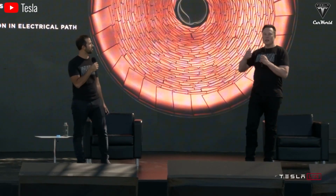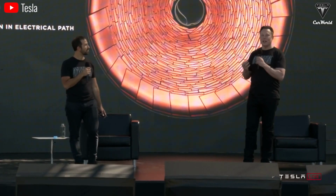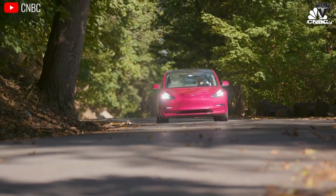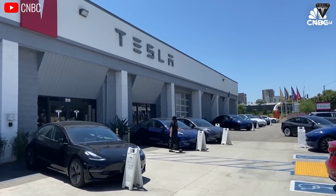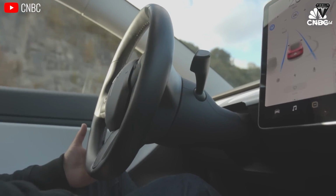Now Tesla has patented a new doped manganese-rich cathode active material that it claims to have increased the longevity of those battery cells. In the patent application, Tesla says that its doping of the material results in better capacity retention at 50 cycles than regular manganese-rich cathodes. 50 cycles, that's still nowhere enough for electric vehicles, as it would represent about 12,000 miles of driving. That said, 94% capacity retention at 50 cycles, that's still a good sign as degradation often slows down, and therefore, the battery could still have decent retention at much higher cycles.